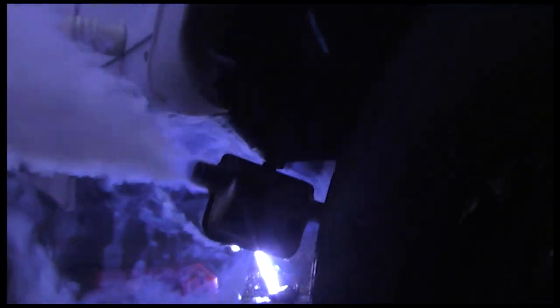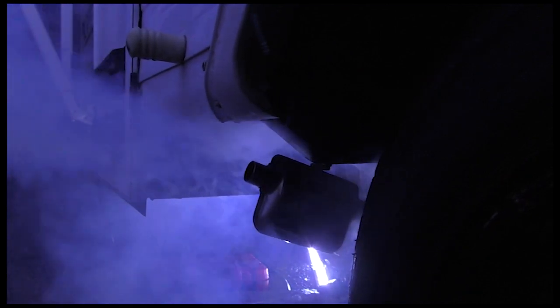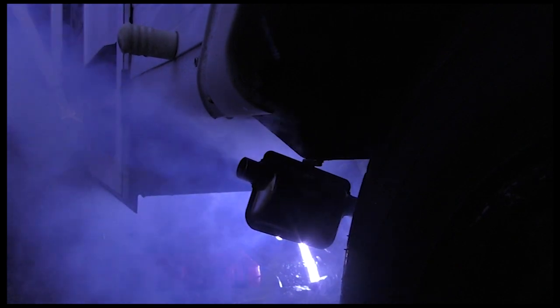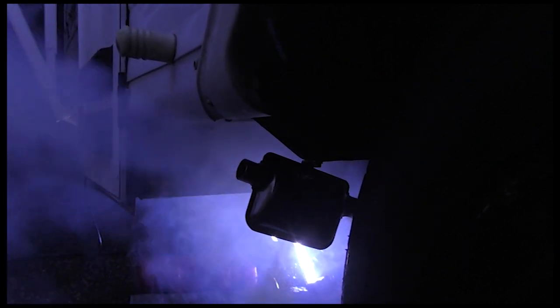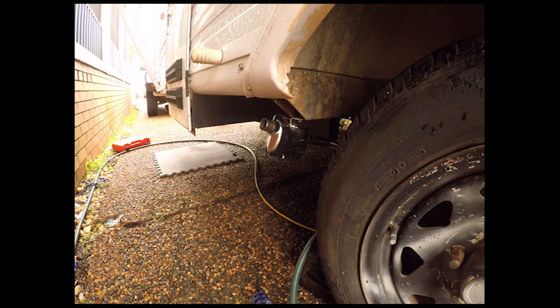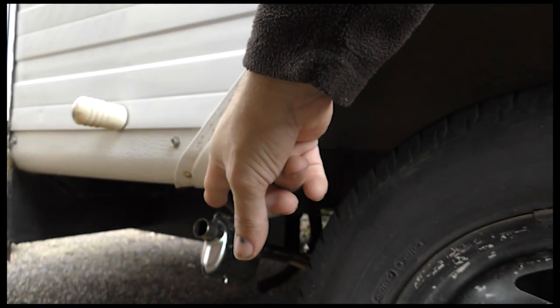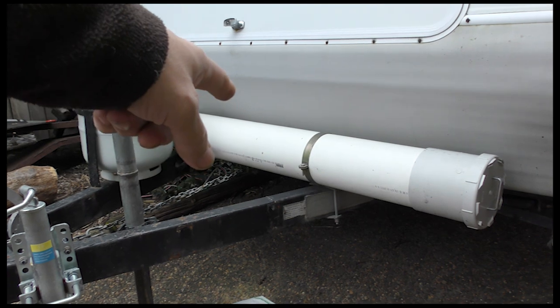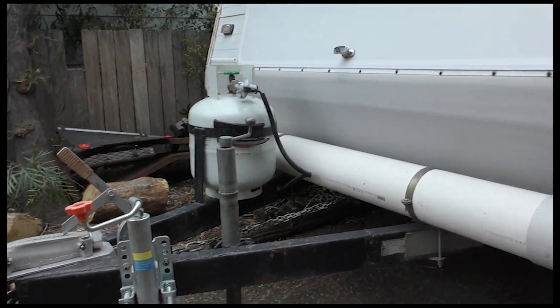Just so you know, this is nothing to panic about. This is actually a good test to look at the muffler — you can see there's fumes coming out the bottom and out the back, so we definitely need to put a hose clamp on the back decking coming back out underneath the caravan. This is standard for your first start — just getting all the air out of the line. You can hear the heat — everything's sort of cracking and making different noises as it settles in because it's heating up. Once it gets running right after the first time, it should run nice and clear. Alternatively, the exhaust is here, straight above those fridge vents. They're typically sealed from the cab itself, but it still allows fume to get in. So I really want to turn this and run it out the front — I'm thinking of getting a piece of aluminium tube and running the exhaust right out the front off the drawbar so it's away from the cab.